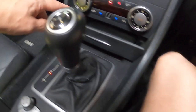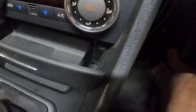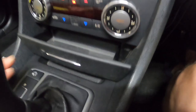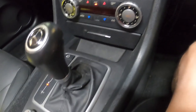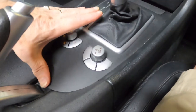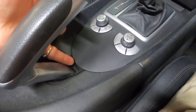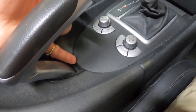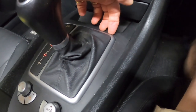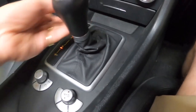For the bottom part, you start by removing two screws — they've got a little rubber grommet over the top just to protect them. There's one on this side as well for the tray. In order to get that tray out when it's unscrewed, you need to lift this trim piece out and move it slightly backwards — that's all you need to do, just move it slightly backwards. You do that by lifting up this end here with a trim tool, and you'll probably need to put a trim tool under this metal surround as well just to lever that up to give you a bit more movement. Then this will slide out.